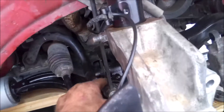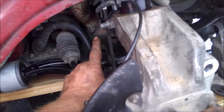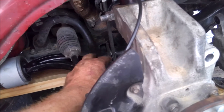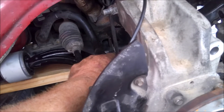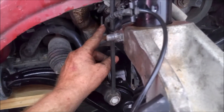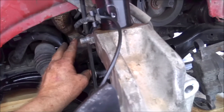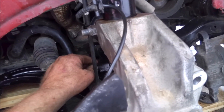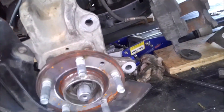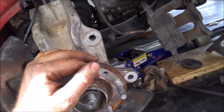We had a hard time finding this axle - this axle was destroyed from the accident. What we found out is Ford changed the axle on the 2010 SHO: they changed the bracket to the block, the bolts, the inner and outer axle - the whole deal. If you have the original axle you may have to switch over to the new stuff. What we ended up doing - since we had that bracket welded to the block - was having this axle rebuilt by a local place here in St. Louis. That way we didn't have to switch over, which wouldn't have been possible with that bracket welded to the block.